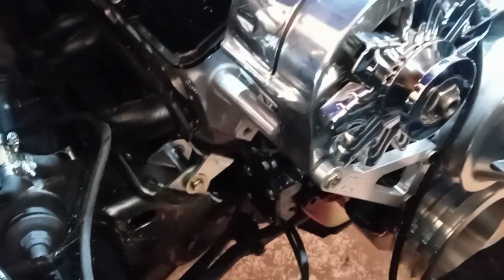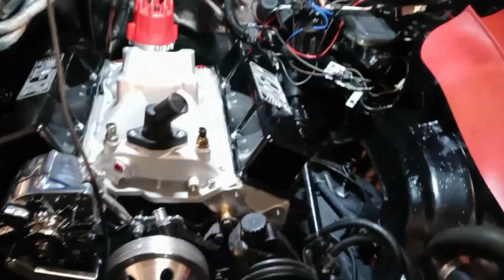All right, we got the motor sent down in here. I got the motor mount set in place. I went on here and ran a bolt in there on both sides. What I did was I changed one of the bolts, because what I said was 3/8. No, those was 3/4 bolts, and it had one side off by here. So after messing with it for about 30 minutes, I just went on ahead and changed the bolts to 3/8 bolts, and they're still grade 8. What else? So we got it sitting in there.